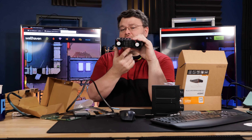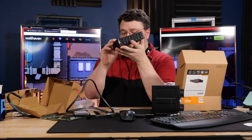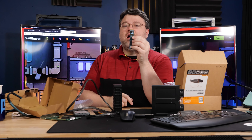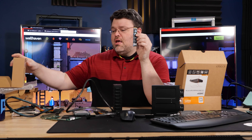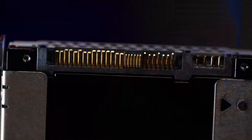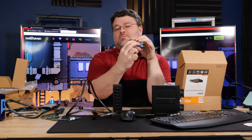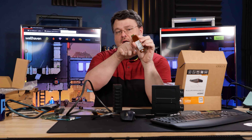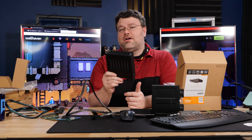It has the same connector as the U.2 version, dual cooling fans with a switch for low, medium, or high. M.2 is not designed for hot swap — if you look closely at the card-edge connector of the M.2, every single gold pin is exactly the same length. That's one of the main reasons M.2 can never truly be hot-swap. By contrast, even a lowly SATA hard drive has different-length pins so the ground connects first, and U.2 is designed exactly the same way with different-length pins explicitly to support hot plug. Do not attempt hot plug with M.2 — you will ruin your devices.